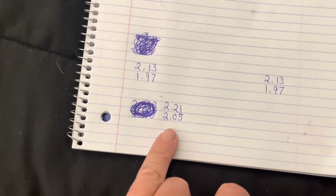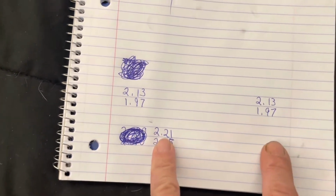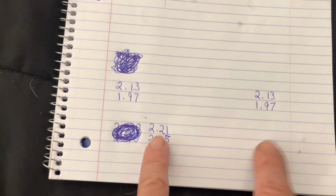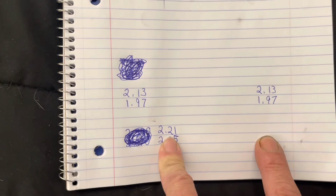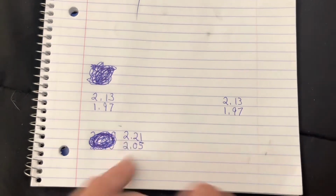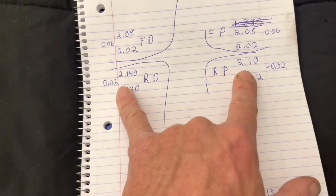And then if I put both rear wheels at 2.1 and 2.05 on the rear, that'll put me at 8 minutes of positive toe on the back. So yeah, and then I'll be within the 10 minutes of each other. And then it's just rechecking camber on this wheel and this wheel after I get all my toe set. I may still have to make further adjustments to the rear after I do a camber adjustment.